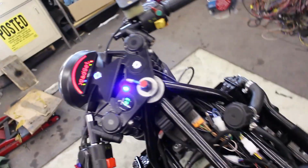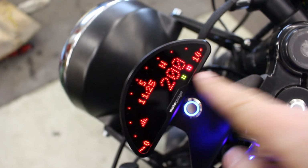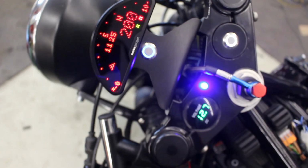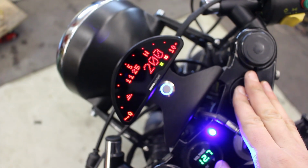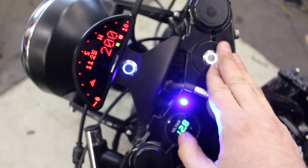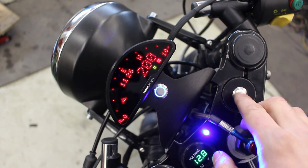Gonna turn on the ignition. Now we should be in neutral. Yeah, this is the oil pressure light. This is my start button. So the engine cranks, but of course we don't have fuel, so it won't start. But we can, let's say, lubricate a little bit, creating a little bit of oil pressure without injecting fuel into our system. So I will give it a try.